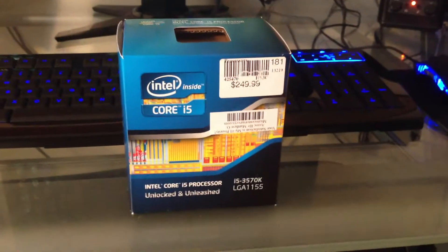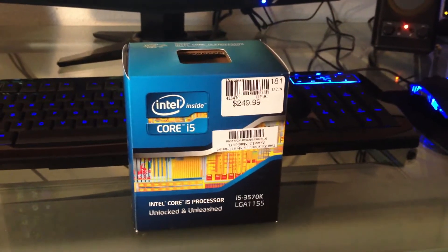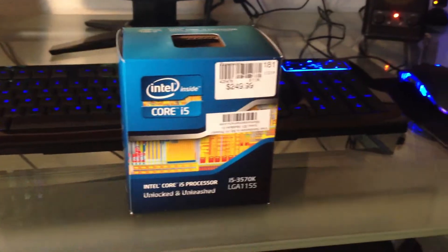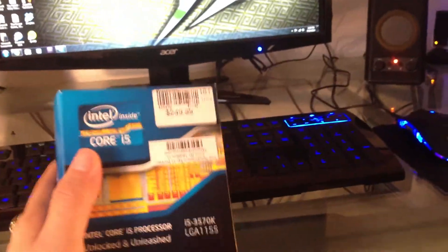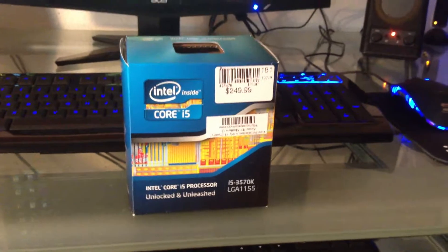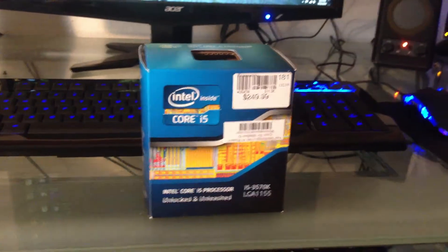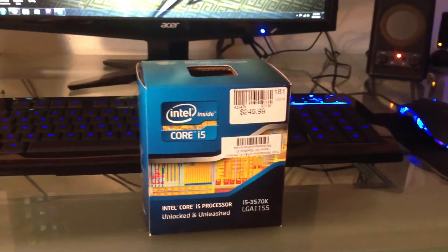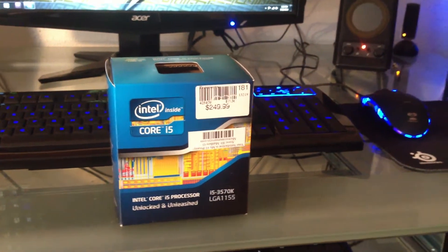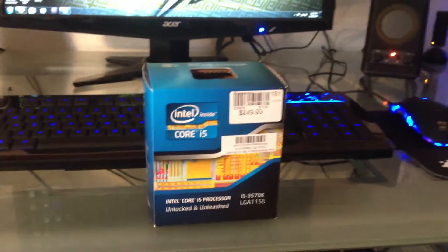It is normally clocked at 3.4 gigahertz and very easy to overclock. First I went up to 3.6 just for benchmarks. Then just this morning I decided to do a full overclock. I am using the standard air cooler that comes with the processor. I managed to overclock to 4.2 gigahertz in literally two minutes. The motherboard has the 3D BIOS, so you can literally click on the processor socket and set the multiplier with your numpad. I changed it from 36 to 42, and boom — 4.2 gigahertz.